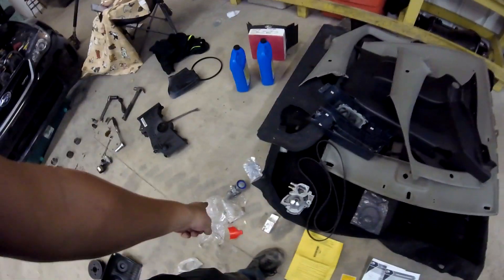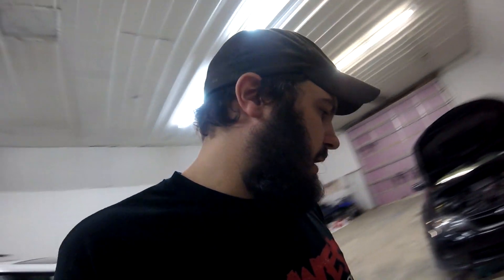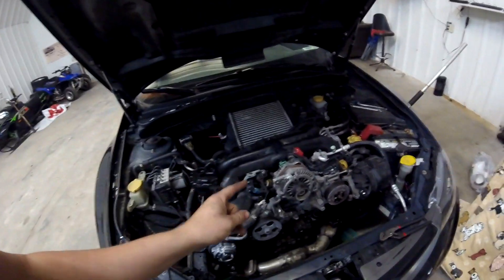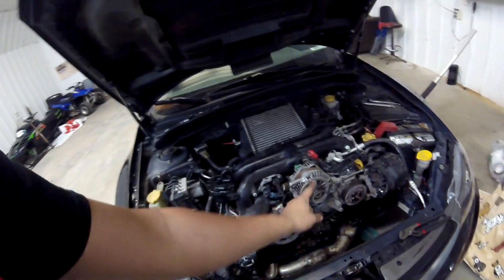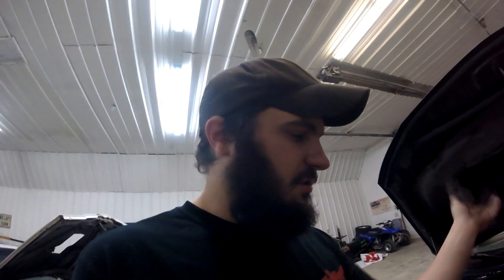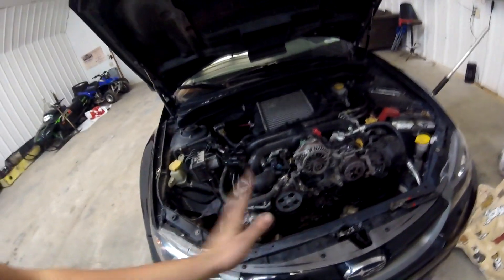The Gates kit comes with the belt, new water pump, tensioner, and all the idler bearings. I also picked up a new thermostat from O'Reilly's since the kit didn't include one. To get in there, I removed the radiator — just two bolts and a couple of hoses — and all the drive belts: one from the crank to the power steering and alternator, and another for the AC. The AC belt is a stretch fit with no tensioner on this model. I didn't realize that and ended up just prying the old one off with a screwdriver. I'll be more careful putting the new one on.